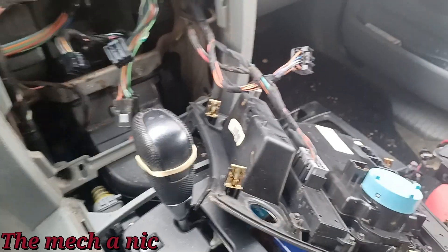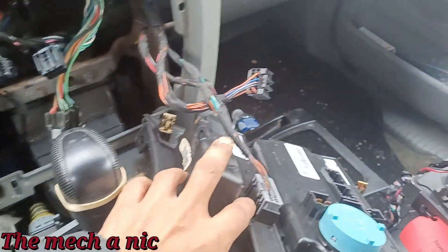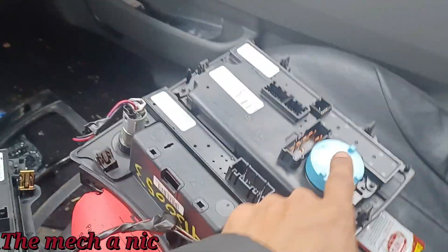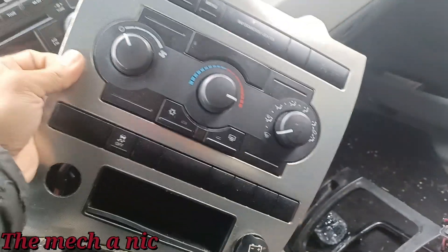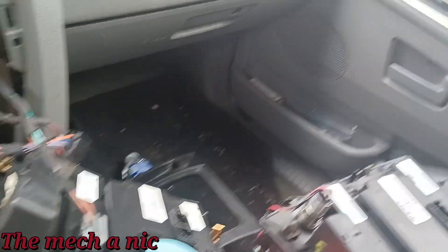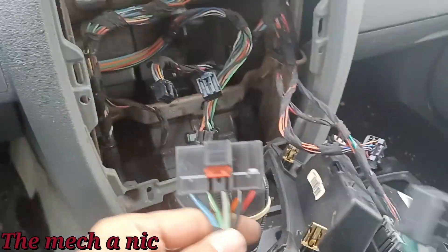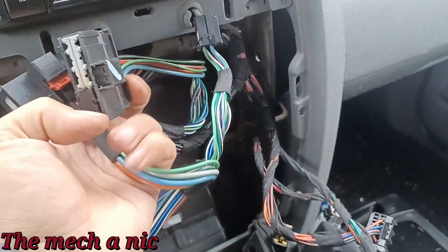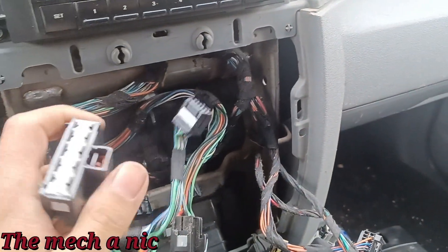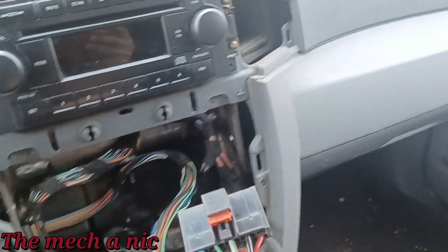I got the whole panel removed out of the dash — these wires are not being stressed, everything is just hanging out. All I'm going to do is transfer the new panel into the existing fascia, because this one looks perfectly fine. I'm removing all the little fasteners around it. As far as the connector, all the wires match up color for color, which is a good sign. We're only going to be splicing in the main connector — the one that melted — not the other one attached here, so I'll get rid of this tape and this connector.